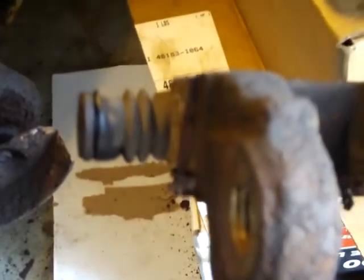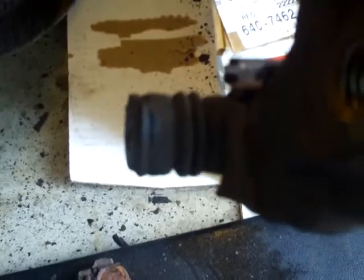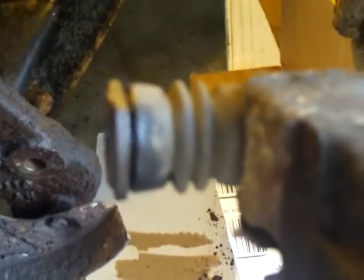The caliper actually floats on this bracket. There are the two mounting holes which mount onto the vehicle. There are rubber boots to keep debris out because these are supposed to be lubricated very well, both of them. So I'm going to pop these off and show you what the inside of them looks like.